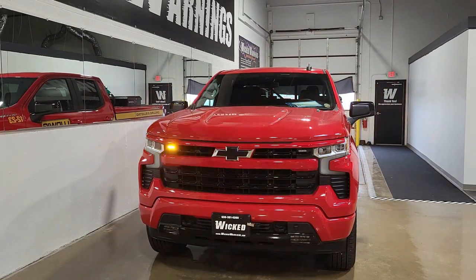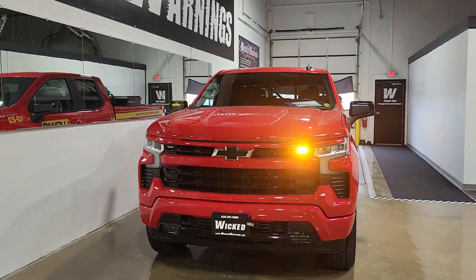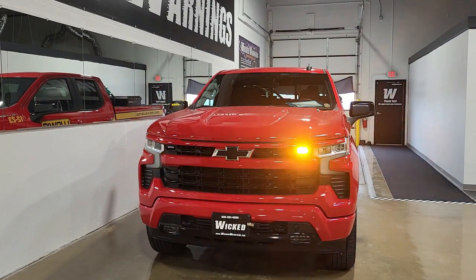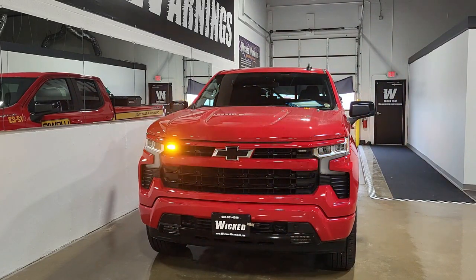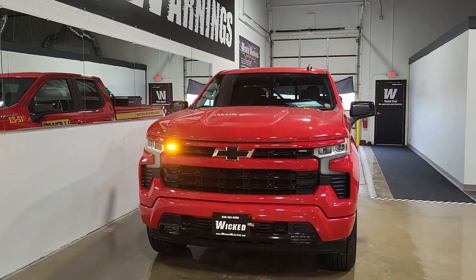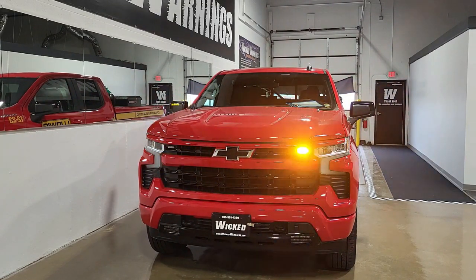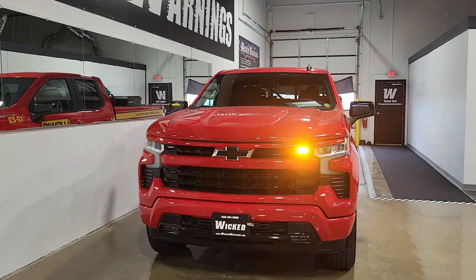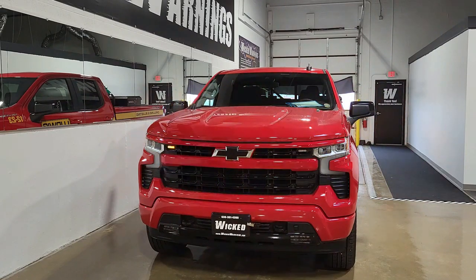So what are we looking at? Right here on the front of this grille, we did have to drill two holes, but we mounted our 3-inch M-Power quick mount there with the VHB and the VHB primer. It's a real nice light and works very well. It's very easy to wire the two leads from the back of those lights right through the firewall via a drilled hole with a three-quarter inch grommet. We synchronized those lights right behind the switch we put in the dashboard and joined the powers and grounds behind that switch as well, with a 22.5 extension wire running right inside to the switch.